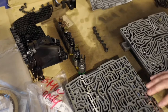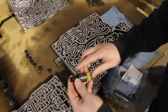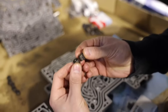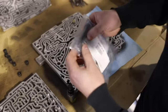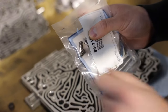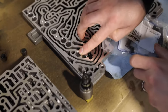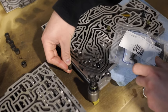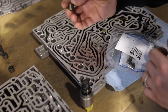The solenoid kit is actually going to distribute the pressure from the main oil pump, and it's crucial for each solenoid to deliver a proper amount of pressure. Oil pressure goes through the solenoid and through the pressure dump rings. You can see how unevenly worn they are because they use rubber material — one of them is actually worn out. The Sonox kit makes the pistons with metal springs, so obviously the metal spring is not going to wear out like the rubber pieces. Before we replaced this one, you'd see the pistons where one would always be sunk in and another sticking out — they're supposed to damper the pressure. If a piston is all the way in, that's a constant pressure loss, and that's when you start getting Clutch A and Clutch E fault codes and burnt clutches.